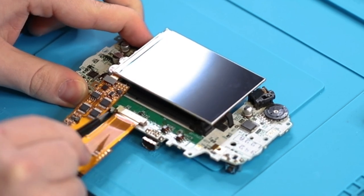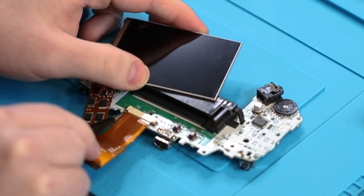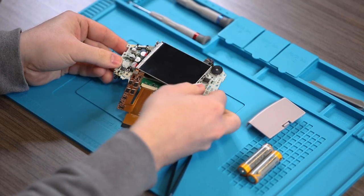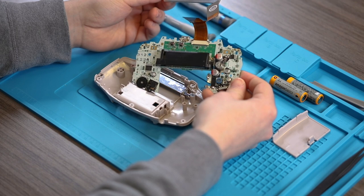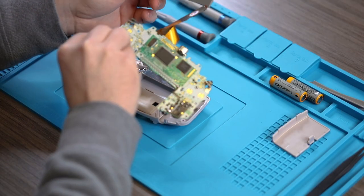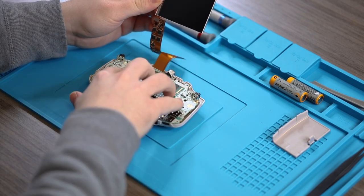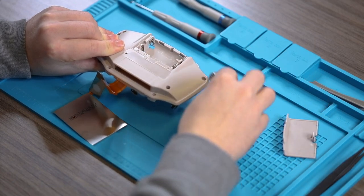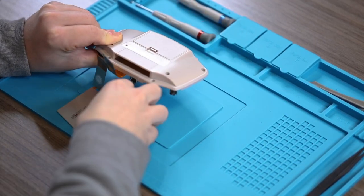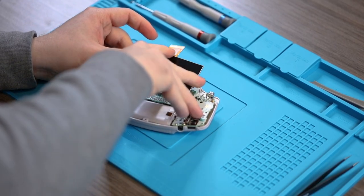When we put the motherboard into the half shell, make sure the black cartridge slot is down and make sure the battery contacts coming off the board are straight and not bent anywhere so it fits securely. Hold the board and shell together so it doesn't fall out, then gently put the batteries in, put the cover on, and then power on — either with your fingers or with a tweezer to help you get the switch across.